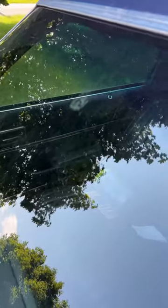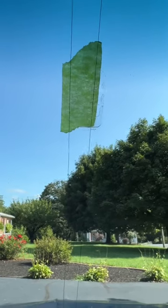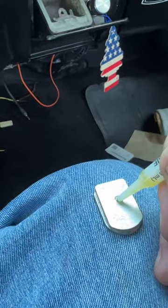With the razor blade. Now with the old glue still on the windshield, I like to put a piece of tape where the old one was. You can see I'm off a little bit, but that's okay. Now just scrape it all off, then apply the cleaner activator to the window and to the button, and apply the adhesive.